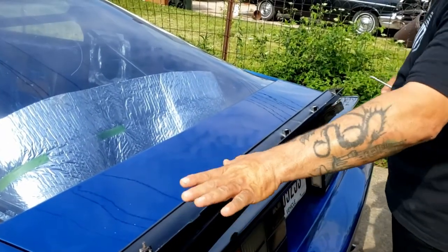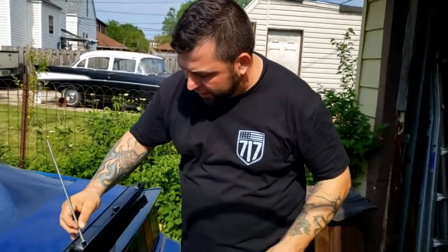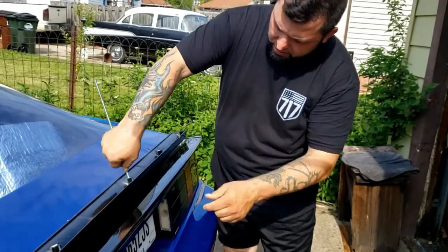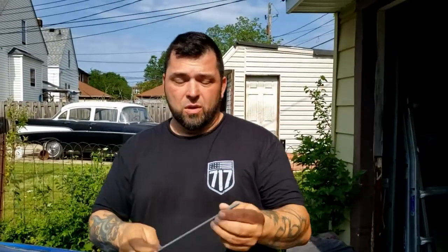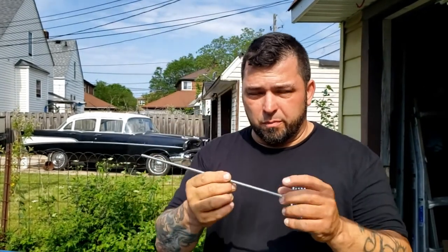so we're at least gonna get four total on there, or even five, but this is 12 inch, so I'm gonna try and cut these at only an inch length, so that when you set it down in there, you've only got about that much hanging out of it, and that should be enough to get the nuts on. So when you buy threaded stock like this, you don't have to use the same that I got, but that's what works. This is quarter inch by 20 by 12 inch long.